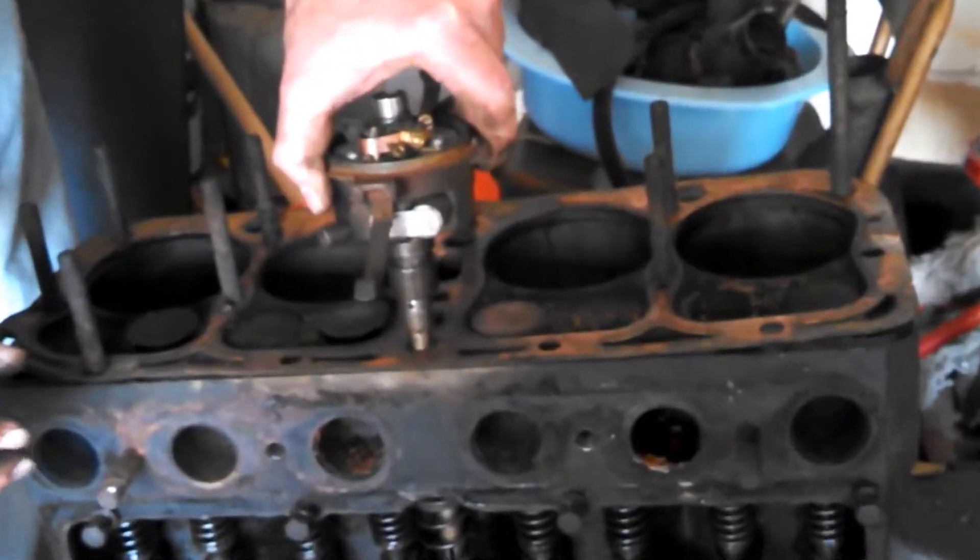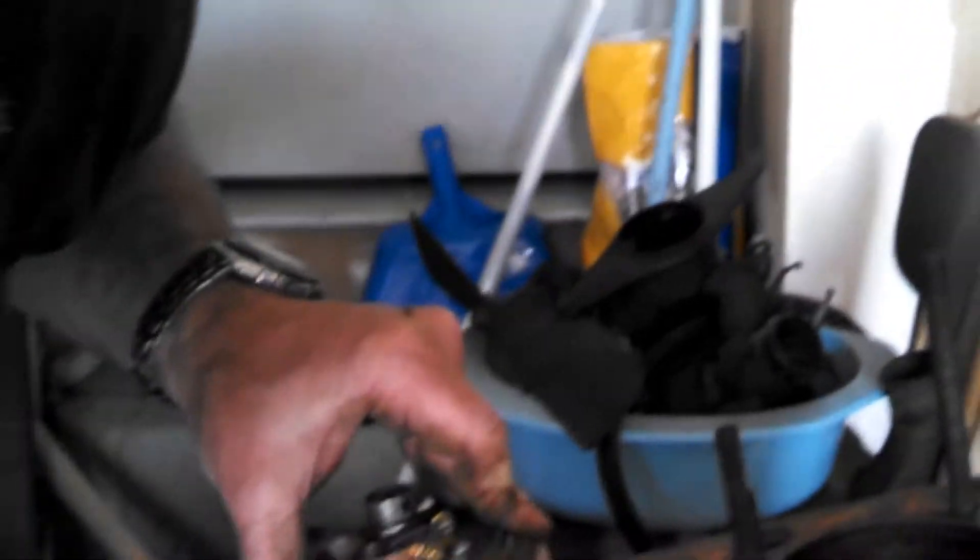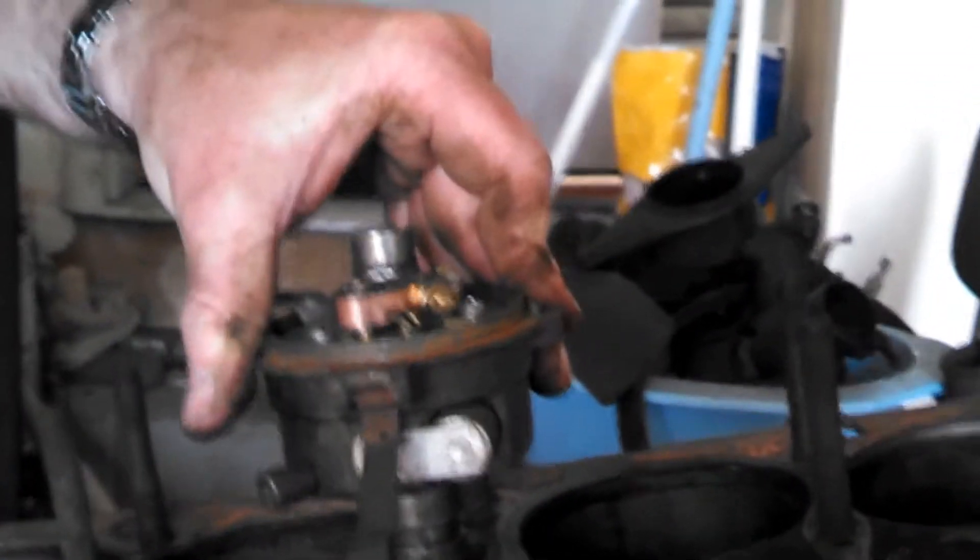So this goes in here like this. When this thing spins - see right here where this is turning - it's causing this to turn. Up here it's the same piece of metal, the same shaft all connected together in there. So down in here there's a gear that's turning this and causing this to go. And then here are the springs to hold the valves down.